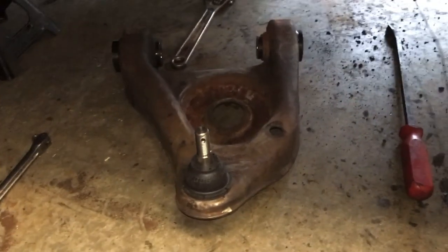Another thing about those bushings — Richard texted me. Once you push them through, they'll poke out maybe about a quarter inch or more out of the other side. It looked odd to me, but once you compress them with the nut, bolt, and washer, they'll compress and it'll look right. So if you bought the polyurethane bushings like I did, don't worry. I got the new control arm just about ready to be installed.